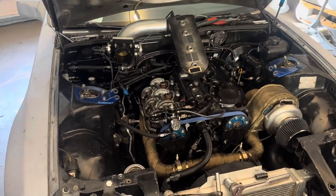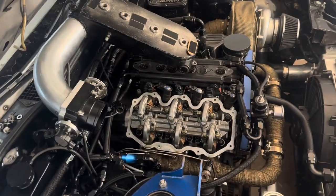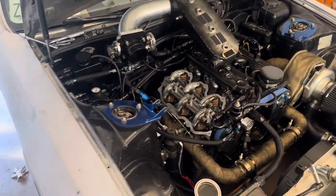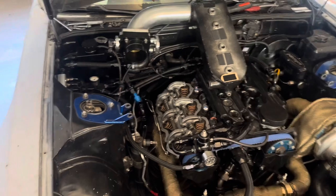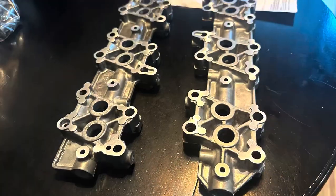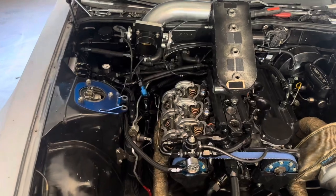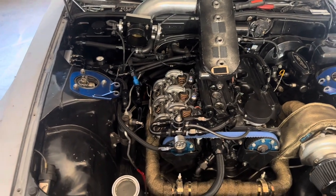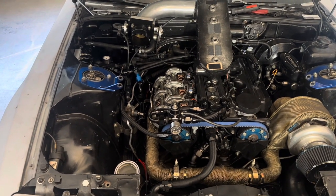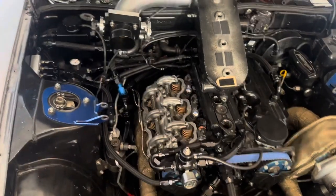What I'm doing now is I'm about to take this lifter tray here out and replace it with the lifter tray that I got redone at the machine shop. I took it down 0.025 of an inch so it'll stop the lifter tick. I also have another set of lifters if I can't quiet it down. Let's see how the car sounds after this modification.